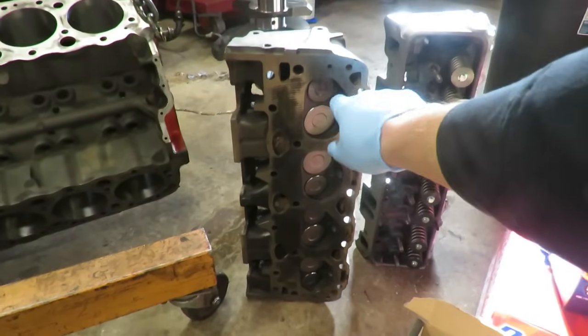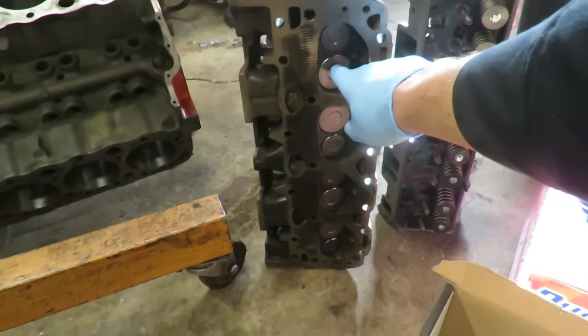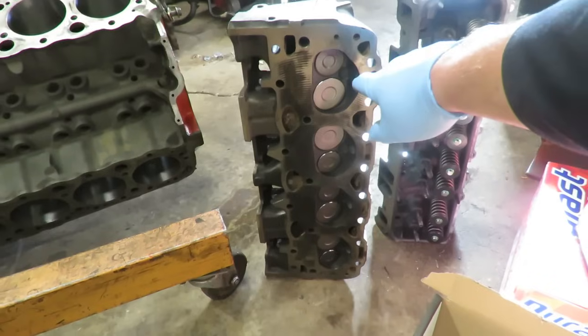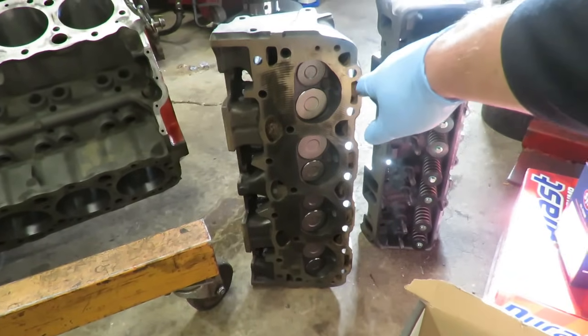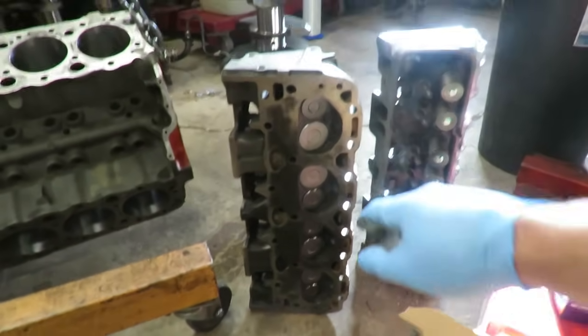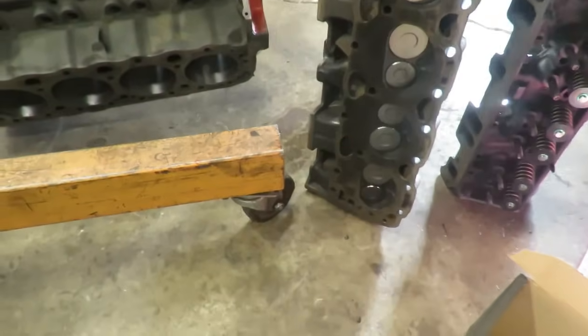So it has a tighter chamber and it makes higher compression. Plus they have the bigger valve. It has a 1.840 intake and a 1.5 exhaust. The non-HO 305 heads have a 1.720 valve. They have a smaller intake. But you'll notice if you look at the surface of this, I don't know how well you can see that,